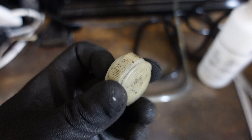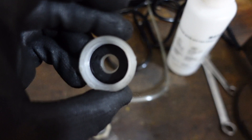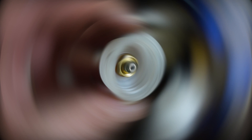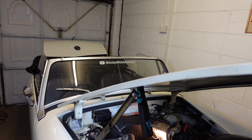I've taken the filler cap off the master cylinder — I wanted to measure it up against the equivalent adapter for this Easybleed. Now what we need to do is get the pipe — you can see there are two washers and two nuts. They need to go either side of this aperture here so we can screw it on, and this will give a nice safe and solid connection for the fluid to run through under pressure. There's a little rubber O-ring to go in here as well.